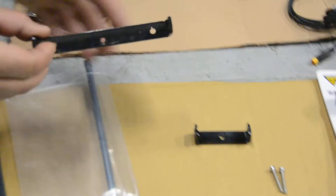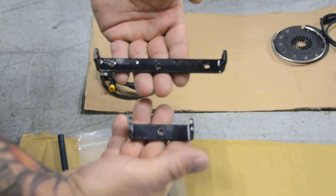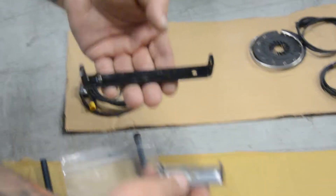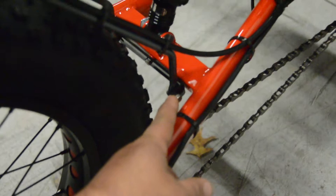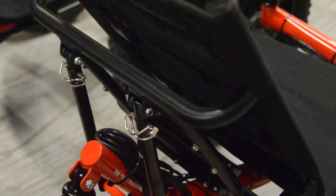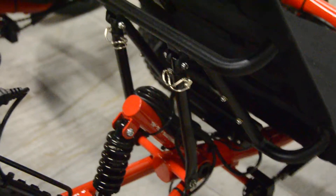You'll also need an adapter — we make two different sizes. The large one fits our two-tiered rack really well, and the smaller one fits the Axiom Journey rack really well. It attaches to the chainstay bridge on the Fat Tad so that you can screw in the rack struts, because otherwise there's not a good place to put them. Resist the urge to fasten them to the back of the seat, because the back of the seat is in front of the suspension coil, so the seat will be moving while the rack is stationary — or vice versa — and that'll break your rack.